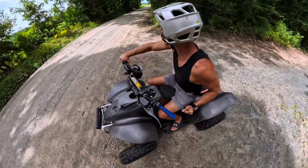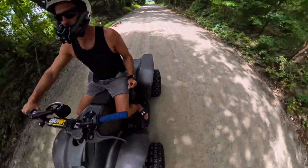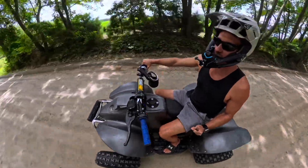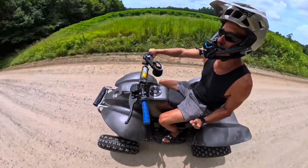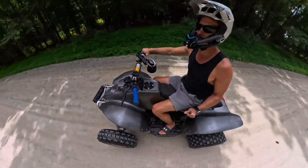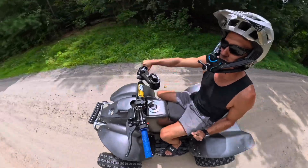I think I have to break this down into two main categories — categories as far as the vehicle. You have bigger vehicle categories like this and my Murray Kilowatt, which can hold quite a bit more battery pack and needs a lot more than a build like a dirt bike or a small mini go-kart. The mini-karts and small dirt bike builds can run one single pack that is 24 to 32 amp-hours pretty easily.